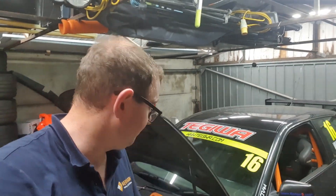I know I said last night I was going to leave it at 1.5 bar, but that was a lie. New spring is in, so we should now be 11 psi just for Cadwell, then I'll take it out and change it back — not a job I'm looking forward to. We're just on our way to the local airfield to do a few pulls in the daylight, just to make sure we can get the boost dialed in and make sure the fuel is okay.